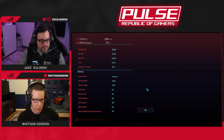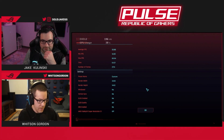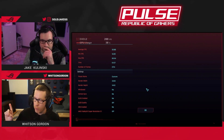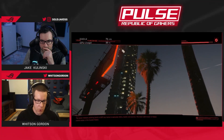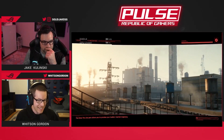We have 33.86 frames per second here. I'll do a quick calculation — even accounting for video capture overhead, that is about a 6% improvement. When I was overclocking without the video capture I saw around 7%. And again, that's over the stock performance of this factory-overclocked card. This card is already overclocked from the factory, so if you're comparing to the stock non-overclocked version and overclock to this level, it would be more like a 9 or 10% boost over stock performance — not bad.